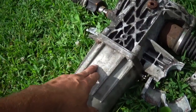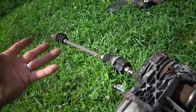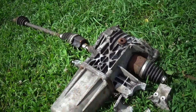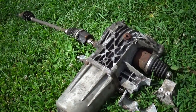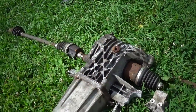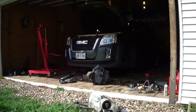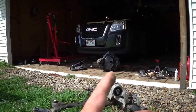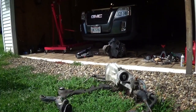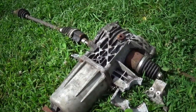I tried doing something funny with the speed sensor pickup — I tried paralleling it to one of those hub sensors just to see if it would trick it into thinking it was there. I didn't even have to move the vehicle. I just started it up and it immediately said traction control, and it was in limp mode — it would only go like 10 miles an hour. So I went to the back of the car, unplugged that module, and it goes normal speed. As a matter of fact now it peels the tires out, because traction control is completely disabled — so one wheel or the other in the front can now just break free.